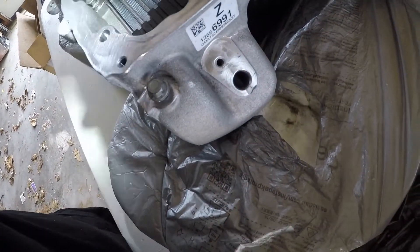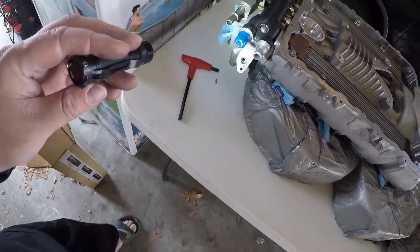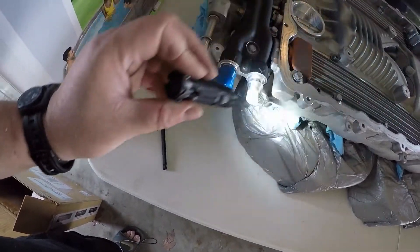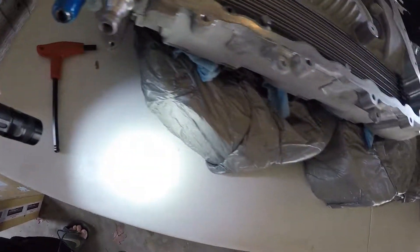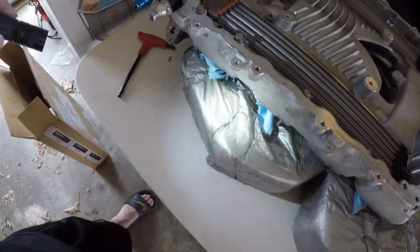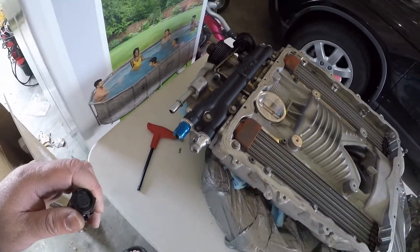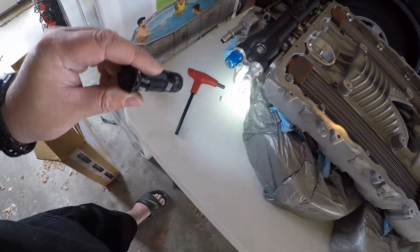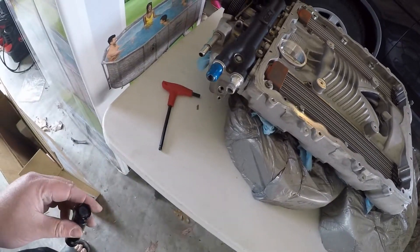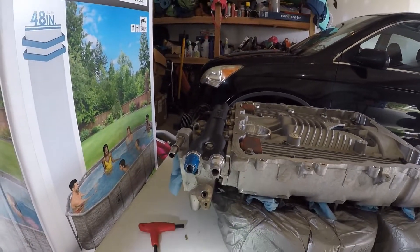That port is open in the back and I do have the T-MAP sensor — we'll install that at some point. The inlet MAP sensor goes up here — that measures pressure before the air goes into the supercharger and gets compressed. Then there's the outlet MAP sensor in the back — that measures pressure after the air is compressed. I'm not sure if GM uses those two sensors to determine when to switch on the electronic part of the charge air bypass valve and open it for high boost situations, but there might be some of that logic involved. Overall these surfaces look pretty good.